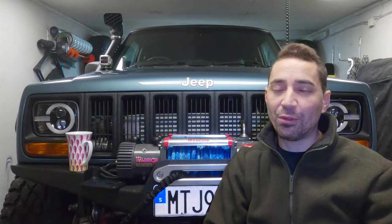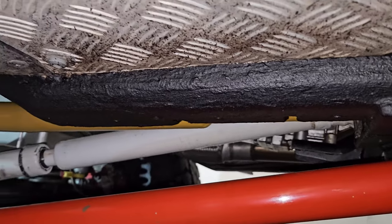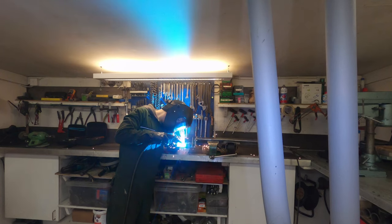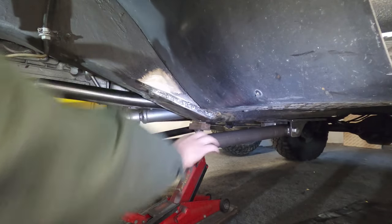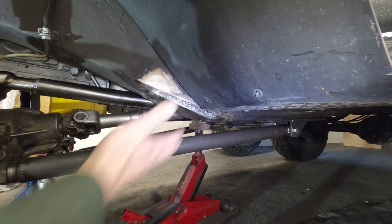Doing all of that together is a really good way of stiffening up the frame without requiring an exo cage or internal roll cage. The best thing about a frame stiffener - and probably the main reason for having one - isn't just stiffening the Cherokee's frame, it's to be able to weld on it. The three-link crossmember on mine is welded straight onto the frame stiffener, so I'm not welding it to two-and-a-half or three millimetre sheet metal like the original Cherokee frame. That's all the stuff I would do right off the bat.